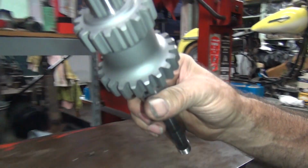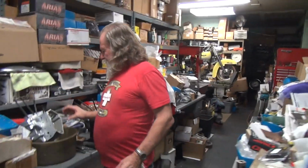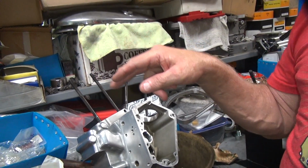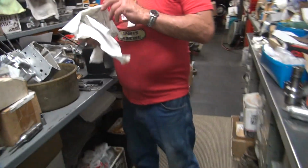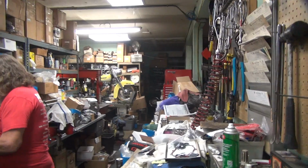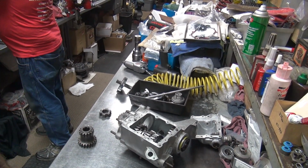Okay, this pressed on now. What are you talking about? On what, in the breather hole? Oh yeah, on the Shovelhead. Your gear, your breather, and there they had a couple of years that they were tapered, at an angle. They were different because you couldn't put that cam from one year to another in. No, there's only two different gears, unless you're talking about UL stuff or really old stuff, but that was a spline shaft, not what you've got there. Maybe I'm wrong. You're talking about something else, I'm not sure what.